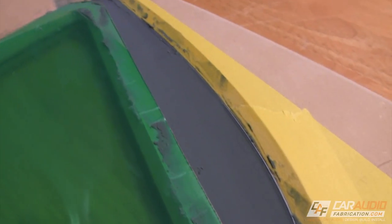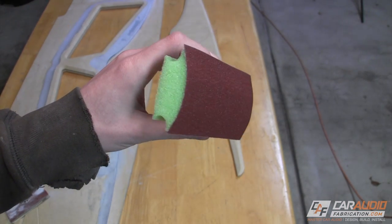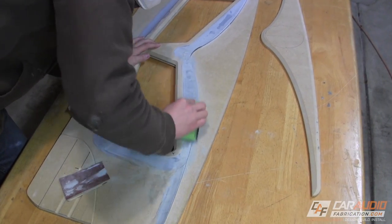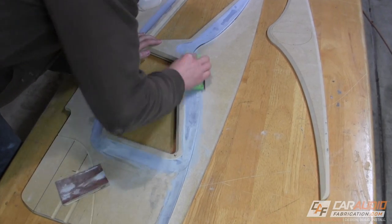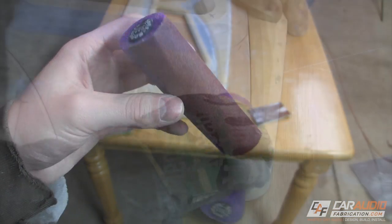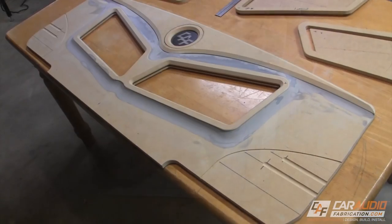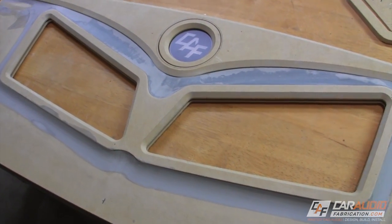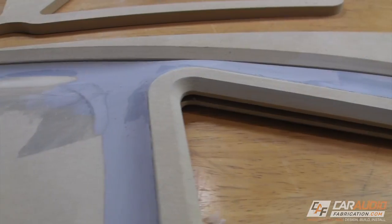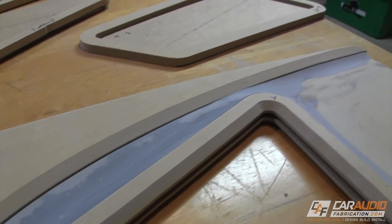Taking care with the application of the filler can save a lot of time during the sanding process. Your filler should be very smooth and close to its final shape. A tool that really helps with the sanding process is this foam sander — link down in the video description. The foam sander allows me to sand evenly on the curved surface, which really helps to make a huge difference in the finished product shape as it helps prevent any waviness in that surface. Foam sanders come in a variety of profiles so you can use different ones for shaping different areas of the insert. Step your way through the grit sizes — I usually start around 60 for very rough shaping, then 150, then 240 in preparation for vinyl. Be careful not to over sand any waves into the filler; if you do, just add filler and fill any holes as needed.